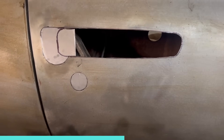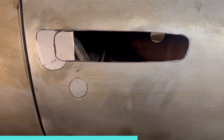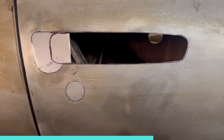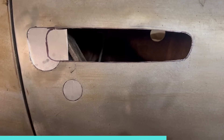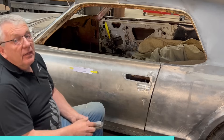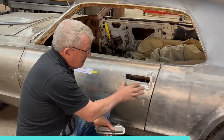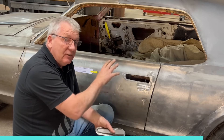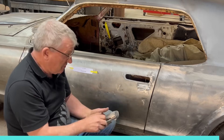I've got my little pieces of metal cut up, trimmed, and sat in the hole. I've reused the template to re-mark where we're actually going to cut the final hole. I've been working on both sides alternately — when welding a fairly soft panel like that you've got to weld a little bit, let it cool down, weld a little bit — so I've been going side to side. We've got this side finished up first, so we'll carry on with the installation.